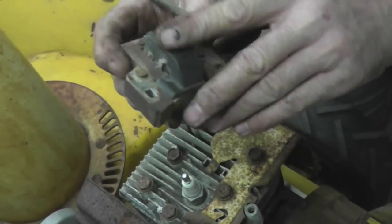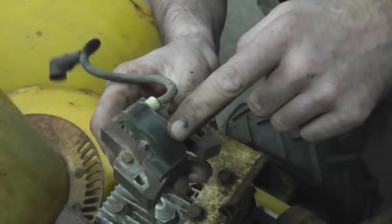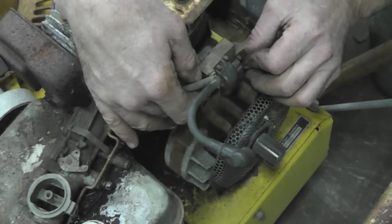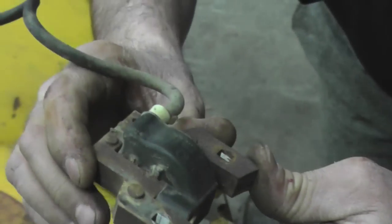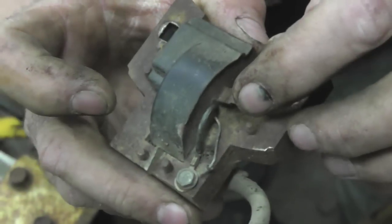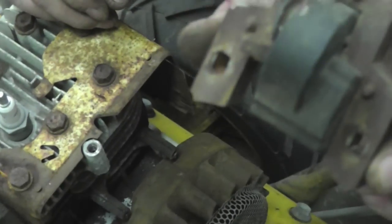These coils say on there 'cylinder side' — this side faces out. If you put this thing on backwards, it ain't going to spark, so you've got to make sure you pay attention to the way it goes on. Right here, with the ground — this is the ground wire right there, that little tab. The only thing that's for is the kill wire, so you can run a wire from there to an on-off switch, whatever you want to do.